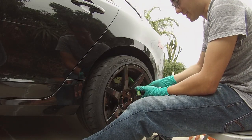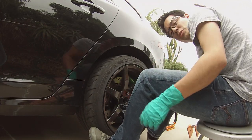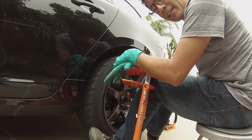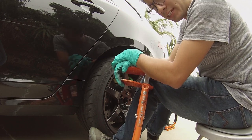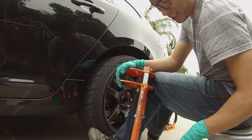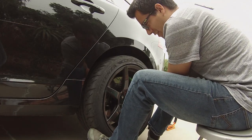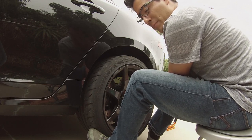So now we're going to move to the rear. We're going to repeat the same process — removing the rear wheel — and let me mention the fancy orange tool I have. If any of you are interested, this is not a sponsored item, it's just a really cool tool. I've noticed it works on most aftermarket brake kits except for Wilwood's for some reason — it does not like to compress the pistons on Wilwood's, and I don't know if it's just because Wilwood's don't come with dust shields so dirt gets in there and gets all clogged up. But anyways, this is called the gyro disc. As you can tell there's plenty of wear on it — the name is even coming off. I can't tell you what website I got it from, but I'm sure Google can. Really awesome — makes changing brake pads so easy, especially if you have a big brake kit.